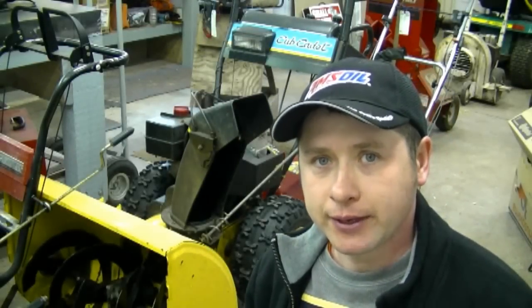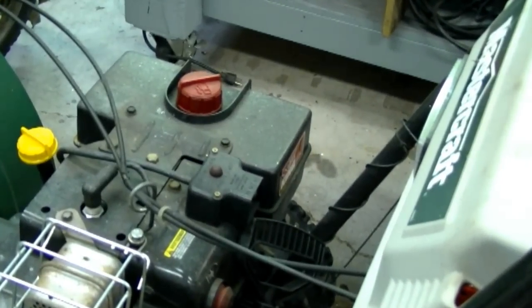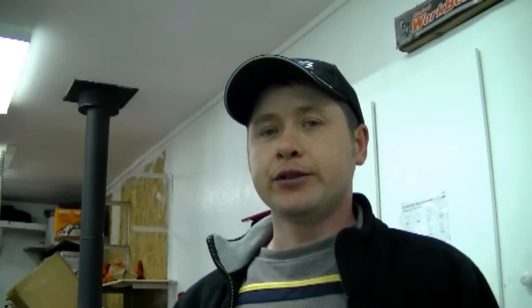A viewer asked: how do I put away my snowblower if it has a metal fuel tank — won't it rust if I empty it? Usually, keeping fuel right up to the top of the tank so no bare metal is exposed will prevent rust. I've done that with many motorcycles. I also add a bit of oil to the fuel, mix it up, and put it in the tank. In spring you can remove the mixed gas if you don't want to burn it, put fresh gas in, and it's ready to go. Most snowblowers nowadays have a plastic fuel tank so this isn't an issue.